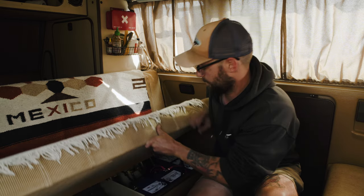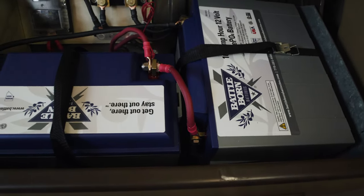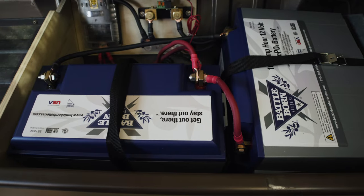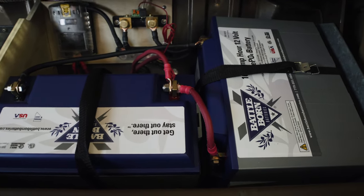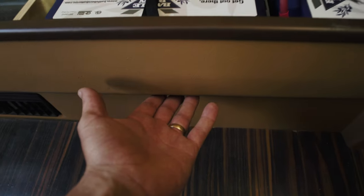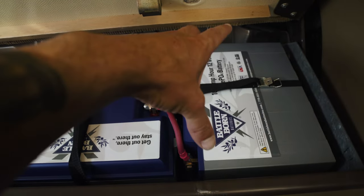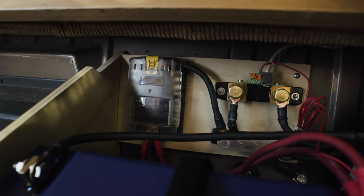Here you have the 200 amp hour apiece lithium iron phosphate batteries. The nice thing about these batteries is that because they don't have any fluid or liquid in them, orientation doesn't matter — you can see we have one on its side and one right-side up, wired in parallel. I had to build small wooden platforms underneath them to get them to fit just right because of our van's weekender edition bench, which has a slightly different taper. It was too narrow at the bottom to fit this battery on its side, so I elevated it slightly to clear the pinch point. They're wired to a fuse panel so we can add more auxiliary devices as needed.